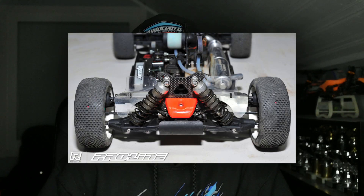Recently there's been a huge popularity rise in the front upper arm wings. These put a lot of downforce straight onto the tire as they're attached to unsprung mass. This can work in your favor a lot of the time, but it's not ideal for bumpier tracks since that downforce is on unsprung mass. Personally I haven't enjoyed them much as the front end gets pushed down quite a lot and it makes the car handle worse over bumps.